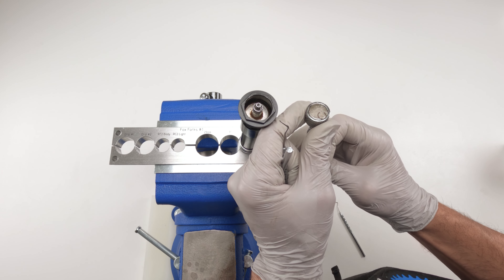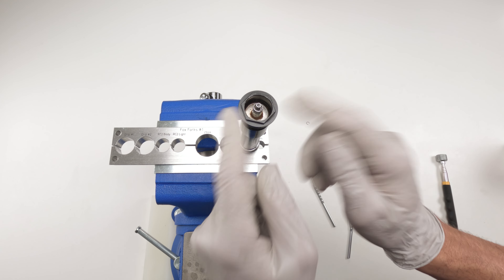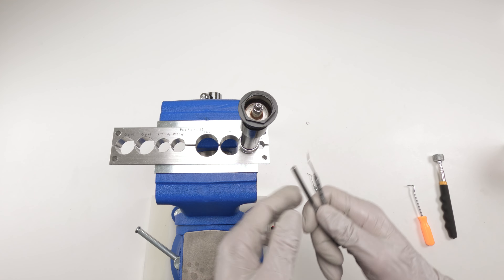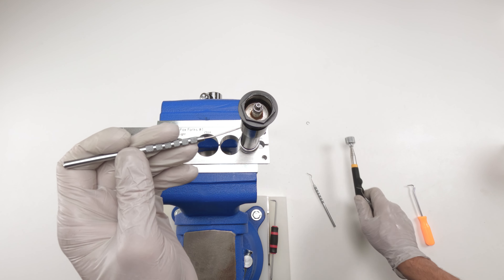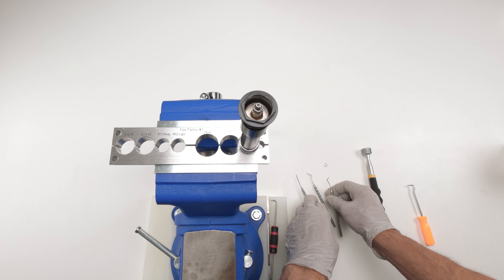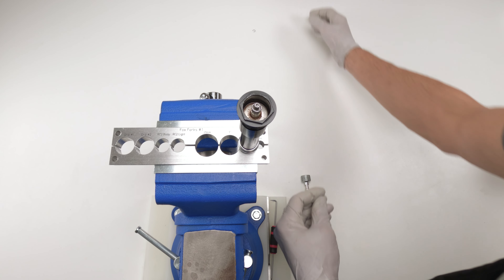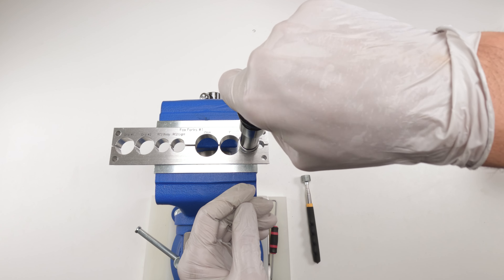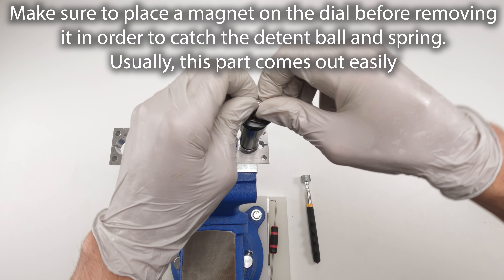We got him. He looks somewhat corroded to be honest, but we got him out. Worst case scenario — try and lift it from one of the two holes, then use another pick with a magnet to find the edge and scoop underneath it to lift it out. Next, take the screw off the low speed compression knob, put the knob back on the side, and screw it into the knob so we can pull it straight up. Wow — I can't pull him up. Something might be wrong with the detent ball and spring — it might have popped out into a different spot.